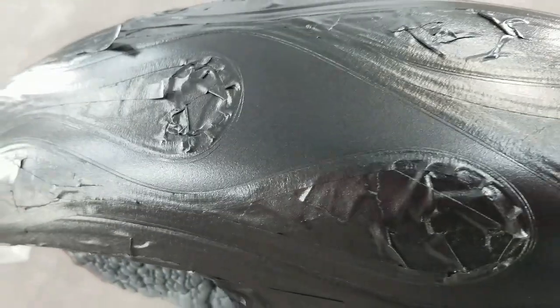As you can see, I've outlined the flames and I got my green protection tape, so to speak. What I've done is just barely dusted a coat of black on here. And what that will do is kind of kill the white and help speed up the covering of the charcoal pearl we'll be putting on here. So I went ahead and did this fender in the charcoal pearl.